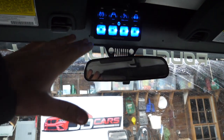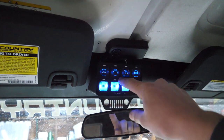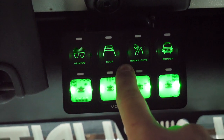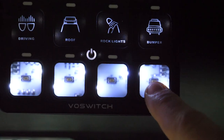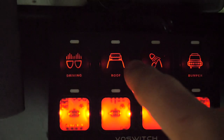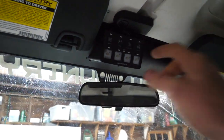I was a little disappointed when I turned this on because I wanted to keep the red backlight for my red theme — but after reading the instructions further, we can actually change the backlight color. Approach the unit while it's off, press and hold for three seconds, and now we can change the backlight color: white, red, green, and blue. I'm going to stick with red. You can also adjust brightness — hold down for the down-brightness or up-brightness controls. I'll probably leave it on maximum or two clicks down. Press and hold for three seconds to save settings.